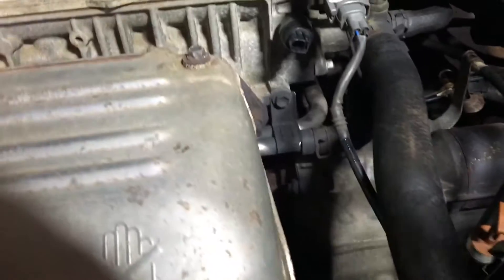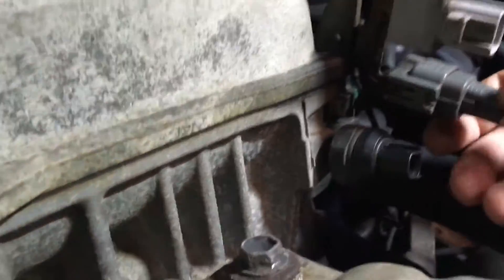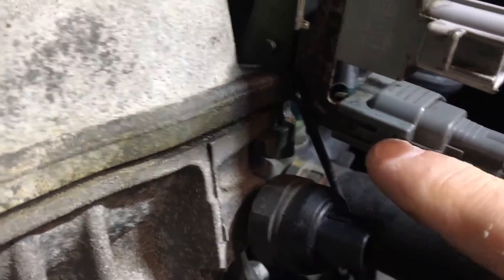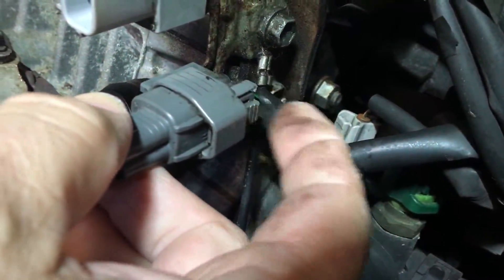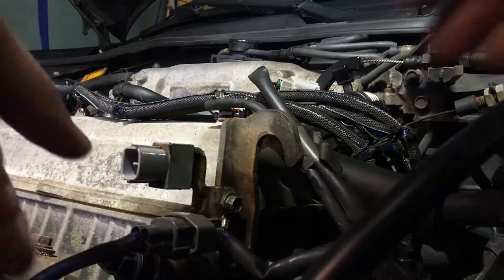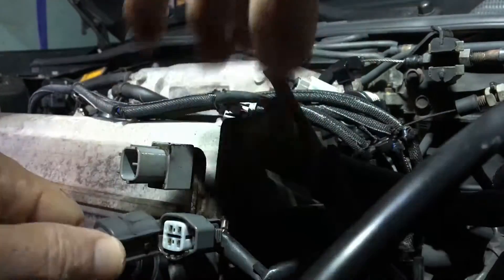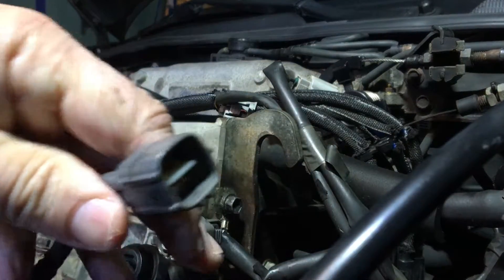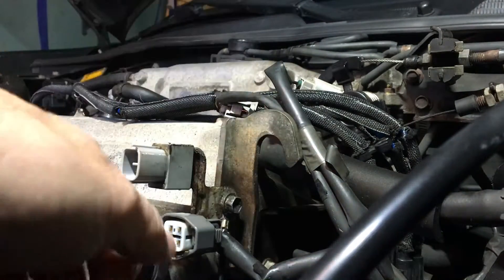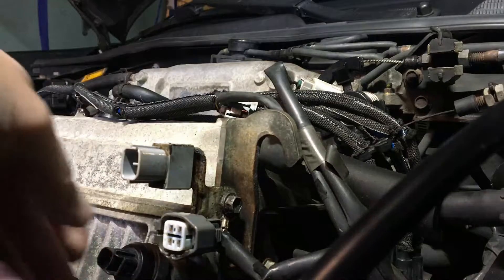I'm holding the camera and trying to work on my car — you know how hard this is. This is not what we're trying to take off. There it is. On this side, there's a button right there. I think it's a two-hander. Push this in and pull. See? That's what we're getting at. So you push this button in and you pull. You don't pull on the wire — you pull on the connector, or you're going to have some bad days ahead.